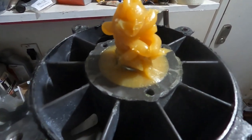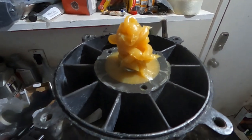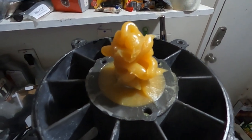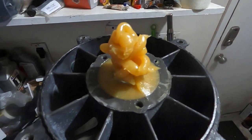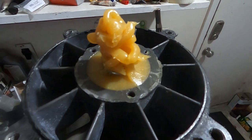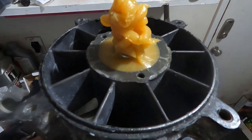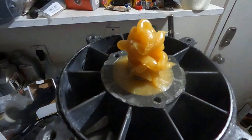Yeah, this is one of my favorite jobs to do. It's very pleasing to press in and out and clean out the cones and things like that. This is definitely a fun job. I hope that you find it as easy and fun too. Again, this pump had 400 hours on it. I had done the original replacement of the bearing about 200 or 300 hours ago. So as you can see, this pump is taking a licking and it's keep on ticking.